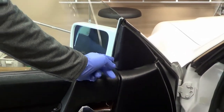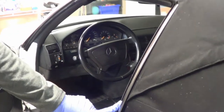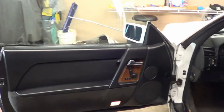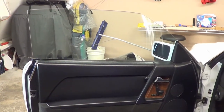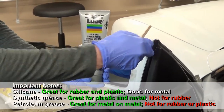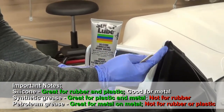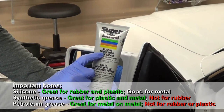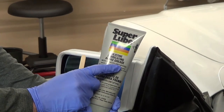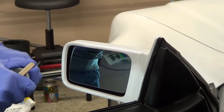This part could be a serious drag on why your window isn't rolling up quickly. We're going to lubricate behind this using something that isn't going to be sticky, that will dry on and ensure a decent glide without showing up on the window. With the windows rolled down, we want to get grease into this channel. You're dealing with rubber components here, which means you've got to use a silicone-based lubricant. I'm using Super Lube silicone lubricating grease — any lubricating silicone would work.